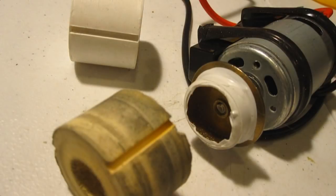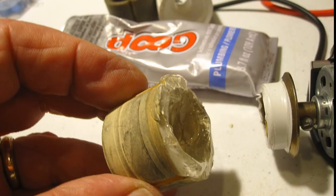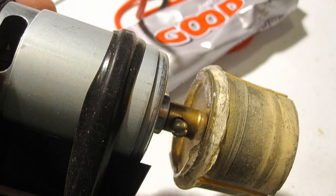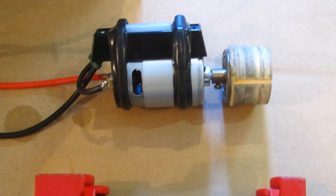I used rubber magic tape to wrap around the zip ties. Next I used an old wheel from my old erector set, using a small amount of vinyl tape to take up the very small difference in shaft size to the hole in the wheel, then tightened the screw. Next I used one of my old rubber engine starter inserts, turned it around backwards so the smaller hole will fit on the engine side to start it. I used Amazing Goop, which is simply amazing — it dries flexible like rubber and just will not come apart on just about anything unless you cut it off. I also put some vinyl tape around the wheel to make sure it'll be a nice snug fit. I then used the goop to overlap the wheel so it's going to stay on tight — let it dry 24 hours to make sure. The starter is real comfortable in my hand and actually only cost me about 18 bucks altogether.